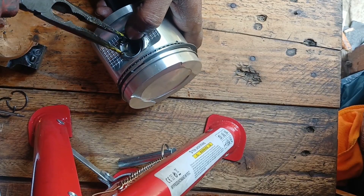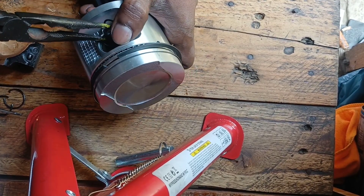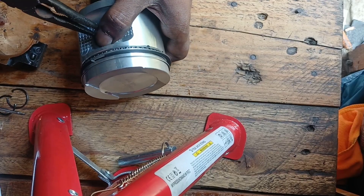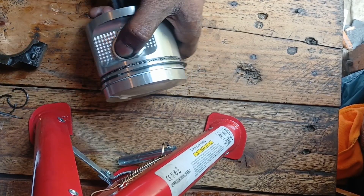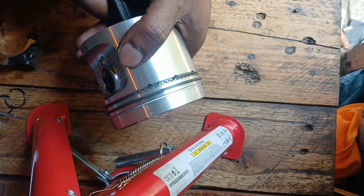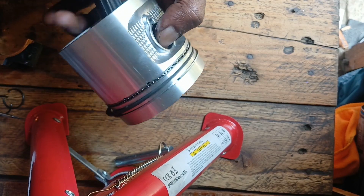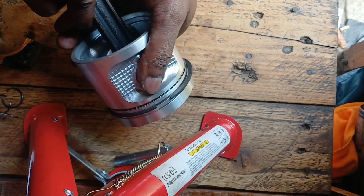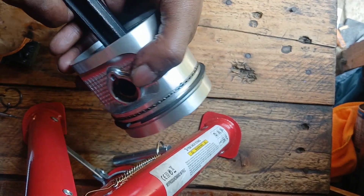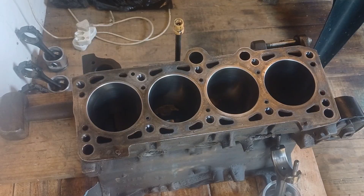Put your finger on it because you don't want it to hit your face. Now my piston is locked. Check the side-to-side play — some side play is normal — but push and pull: you don't want to hear any knocking noises, because that means your gudgeon pin is damaged.